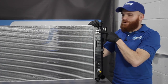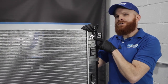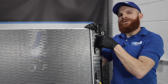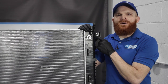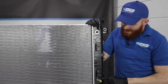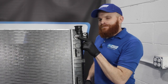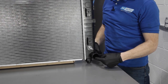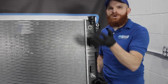I want to emphasize that if you happen to see these fittings — which is where your transmission cooler lines are supposed to go — and your vehicle didn't come with that, maybe you have a manual transmission, it won't have transmission cooler lines going in here. People will generally get a little worried and say, 'Mine has an extra part, what do I do?' The system that goes from the transmission cooler lines to here is a completely separate system from the cooling system that runs through the radiator. If I blow air through the transmission cooler inlet, there's no air coming out of the coolant ports — but there will be air coming out of the transmission cooler outlet. They are entirely separate.